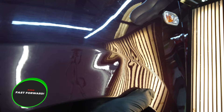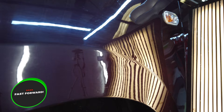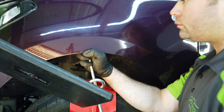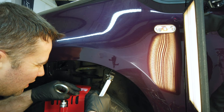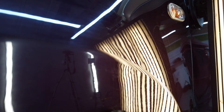Like I did with the first part, I'm going to get this area really nice and warm. Then I'm going to go right to the centre, start pushing it out — and you can notice that I've got my thumb on the edge just to stop the edge from blowing out. Once the centre of the damage has started moving I'll start tapping around the area with my blending hammer to tap down all the crowns. Changing my repair direction again, I'm now repairing the horizontal crease just below the body line. Before I carry on with the repair I need to strengthen the lip edge — as you saw earlier it's already buckled and lost its strength. So I need to put these vice grips on there to minimise the chance of it blowing out anymore. These are mainly used by panel beaters to hold two panels in place while welding them together.